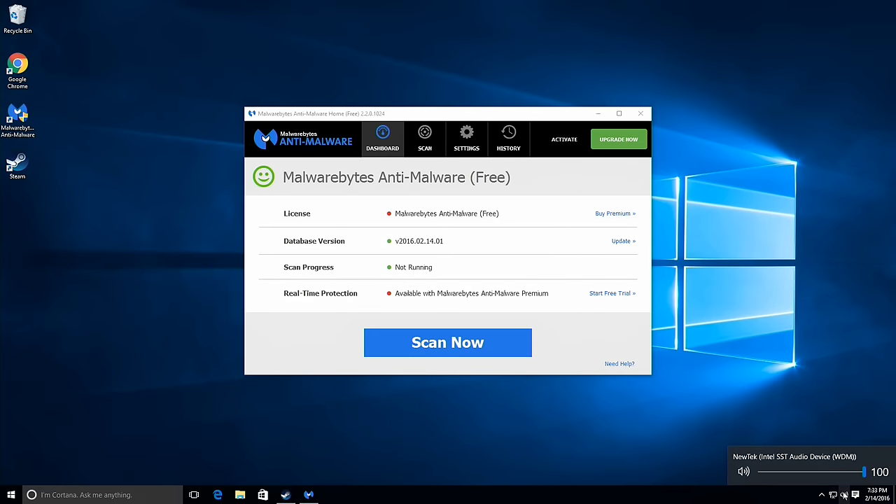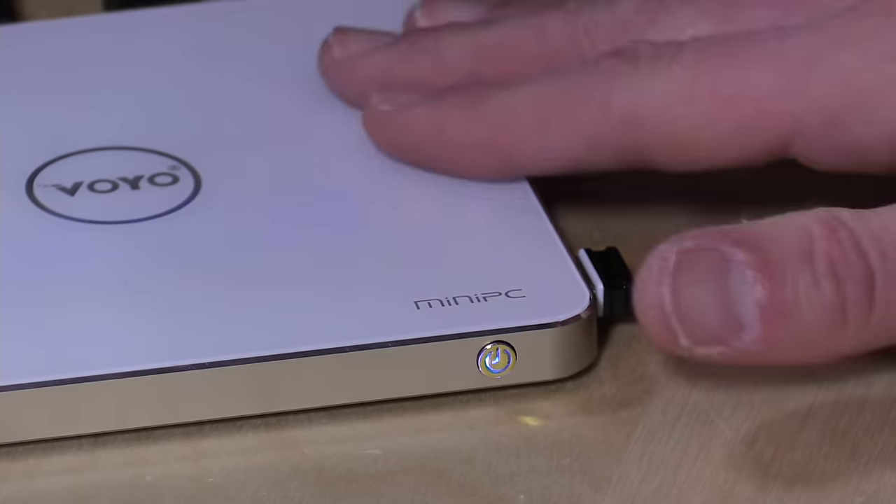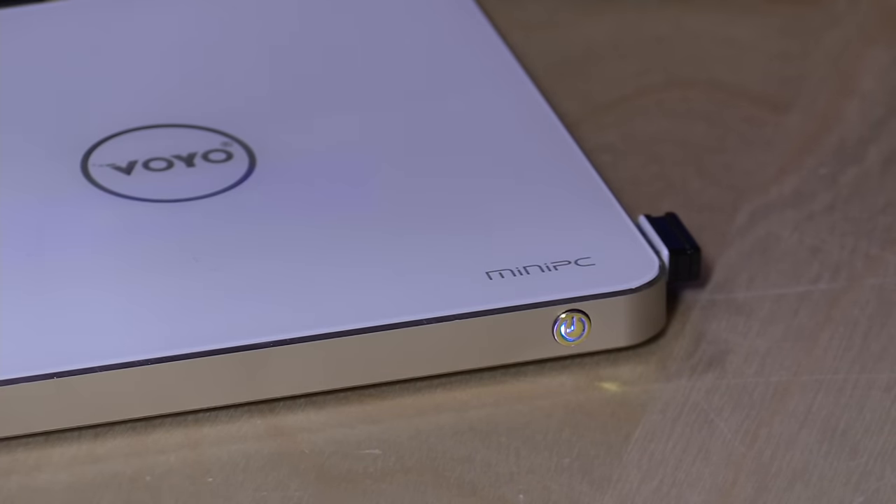One other thing I noticed is that the built-in Wi-Fi, although it says it supports 5GHz networks, this one doesn't — it's 2.4GHz only, wireless N only, not wireless AC. So while they packed in a lot of great stuff including large RAM and storage, they are not including wireless AC, which is something you'd expect from a premium mini PC. The reception didn't seem all that great either, so we'll be using a USB to Ethernet adapter for our tests.